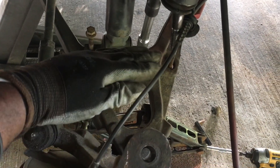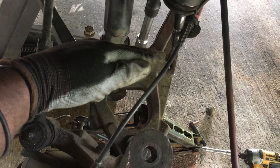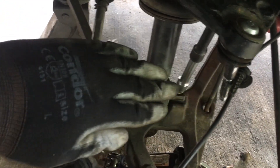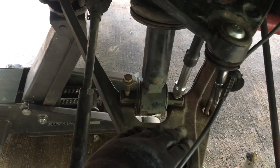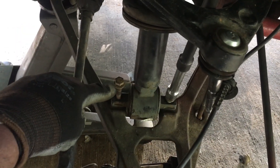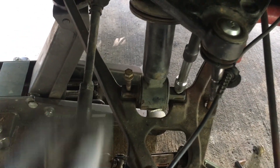These things here - they're bent like that because they're used to being like that. But when I put these spacers on, I gotta offset them, so I gotta turn the strut around. Now from being this way, it's that way, so it's not flush with the lower control arm anymore. The strut is so used to being one way and now it's the other way, so I have to beat these bolts down in there so this thing can level back out. That's why I got this hammer - knocking it down on here, do the same thing for that side, tighten them down and we'll be on the way.